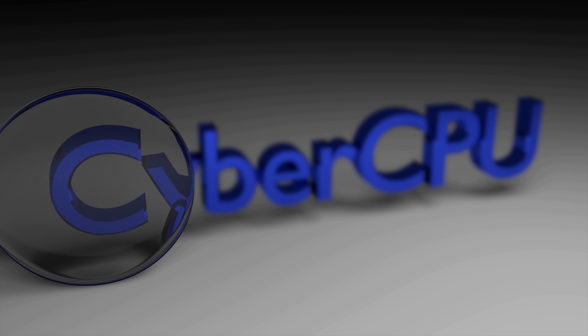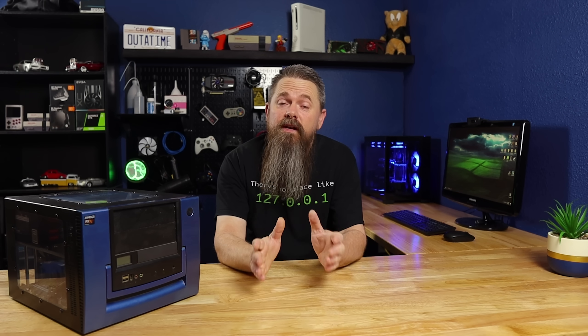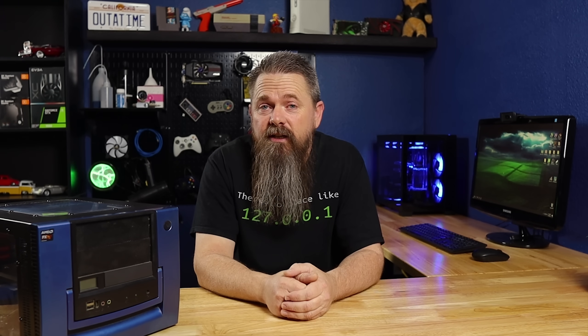We just want to make sure you have the most secure computer possible. Windows 11 has some pretty crazy hardware requirements — pretty crazy considering previous versions of Windows. It requires an 8th generation Intel processor or higher, a TPM chip, and a UEFI BIOS with a GPT partition. This is so you can enable secure boot. But ironically, Windows 11 doesn't actually need you to turn on secure boot — it just has to have the capability of turning it on.